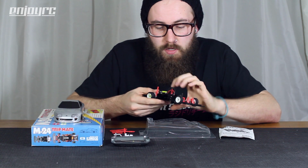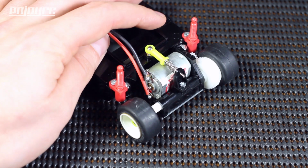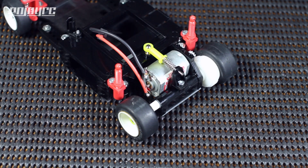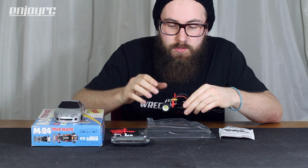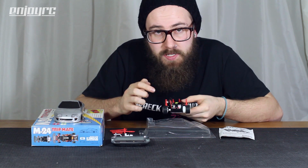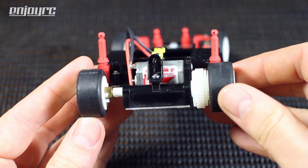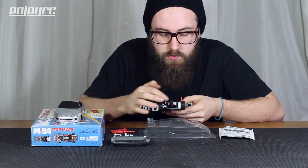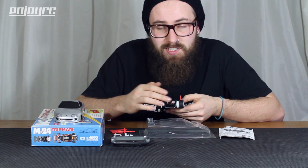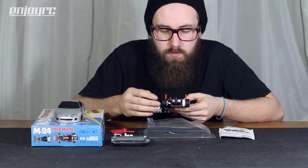So for the rear, like I said, now has a mid-motor, a top spring setup, a T-plate on the bottom. Also, what I found out is that the rear axle itself, so the shaft, has been replaced. So this is the old one. The new one for the M24R actually is a little bit wider. So it still uses the same spacers to get the width here on one side. On the other side, all of the spacers are gone. You can see that the tire is now much closer to the differential to get the same width. So the stock suspension on the rear is wider than normal. You can still widen it a little bit if you wanted to, but I think I actually had it on one of the widest settings, so I don't know why you would, but you can.